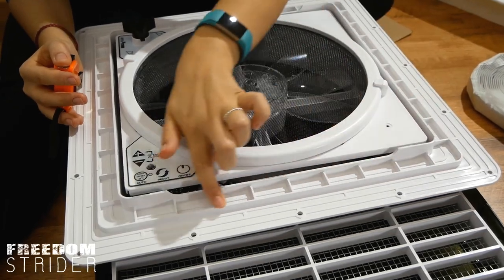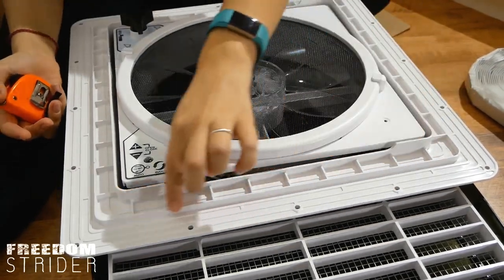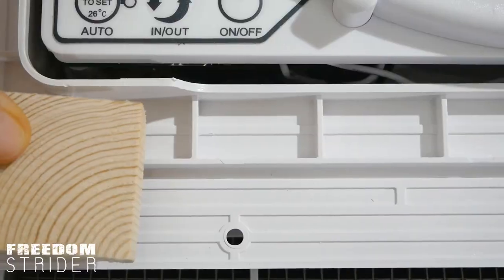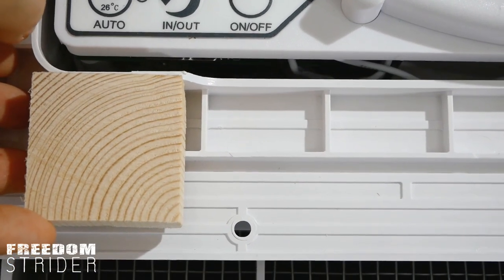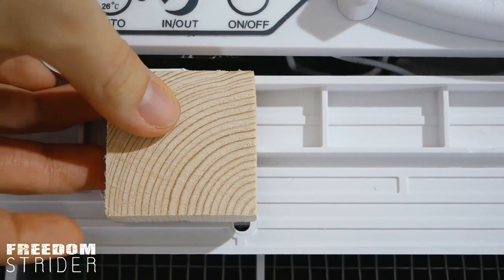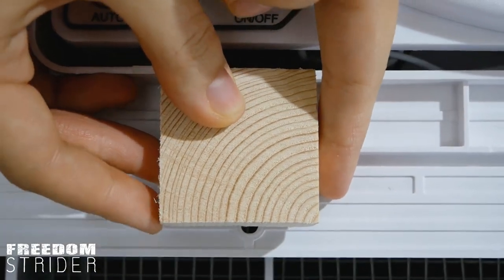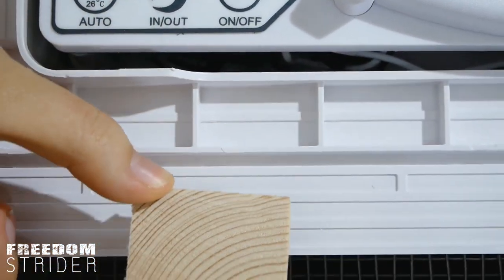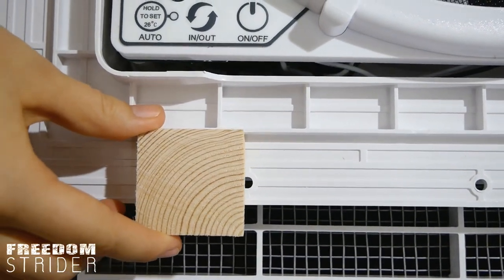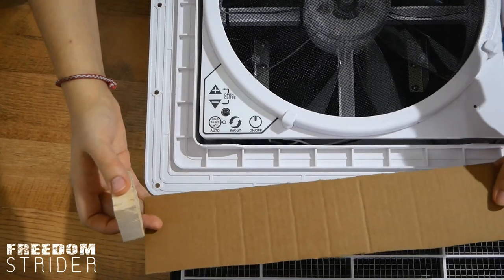What is confusing about this model is that it has this extra channel here, because a lot of other fans — like the Fantastic, or the smaller version of this model — don't have this rim. A lot of people cut the hole and the frame around this box. If you put the frame right next to the inner box, which is the 355 square box, the standard cube wood people use — about 5 by 5 centimeters — does not cover the holes. The screws will only go halfway in, which is pretty much useless.